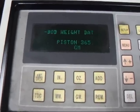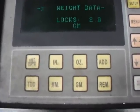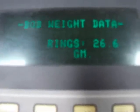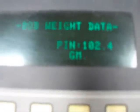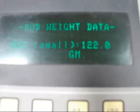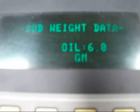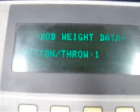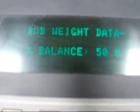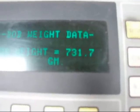I've taken it and started all the critical dimensions here into the computer. We've got a piston weight of 365 grams, locks at 2 grams for the pair, piston rings at 26.6 grams, piston pin at 102.4 grams, big end of the rod at 369.9 grams, small end at 122 grams, insert at 46.8 grams, and we're going to add 6 grams for oil. We have one throw per cylinder and one throw on the rods. Balancing it at 50% gives us a bob weight of 731.7 grams.